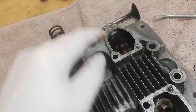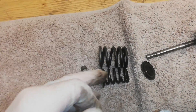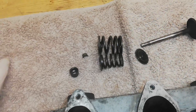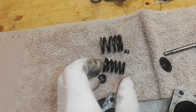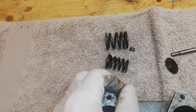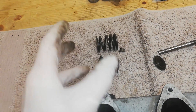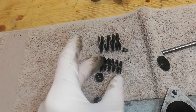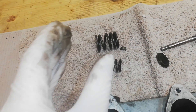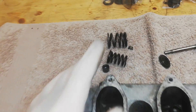From initial inspection we'll be replacing the valve guides, possibly the valves as well. The other thing I'm going to do is measure the free length of the valve springs, because they can be shortened. On an engine there's always one or two valves fully open where the springs are fully compressed, and it can sit like that for years, which can serve to shorten the springs. We'll be checking those later.